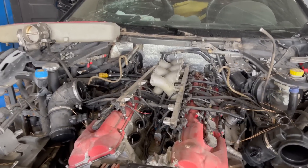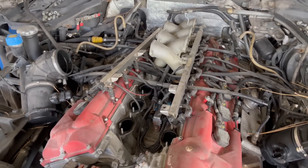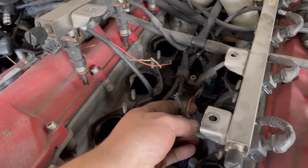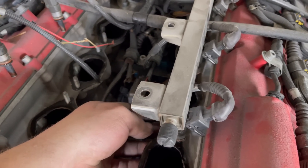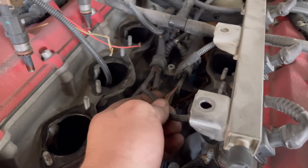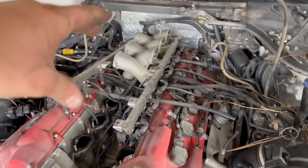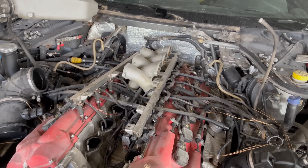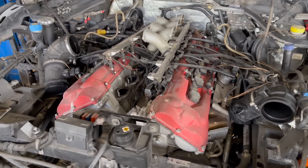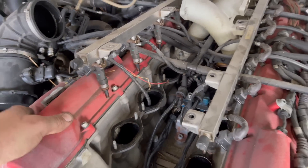Check it out — we got the intake plenums off, and it comes apart like a Lego set. You take off the side pieces, then the fuel rails, and all these pieces are individual units. We found four wires that are ripped — two are for the first fuel injector and one on the other side. It looks like a rat, snail, or squirrel was in here chewing up these wires. They only got these two front ones and didn't go any further. We're going to get the bore scope out to check all the wires in the back, but if everything's good we won't need to dig deeper into that jungle of wires and vacuum lines.